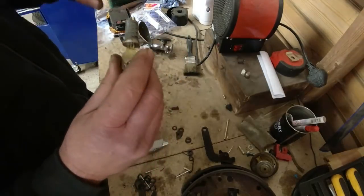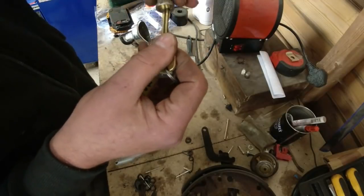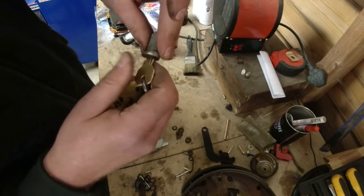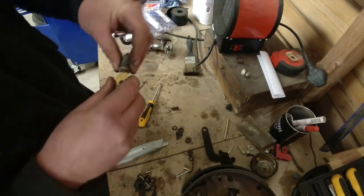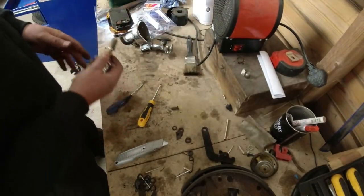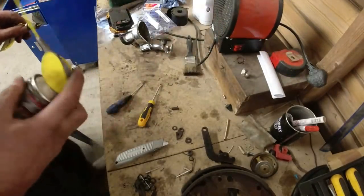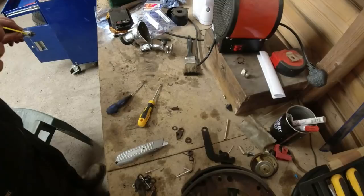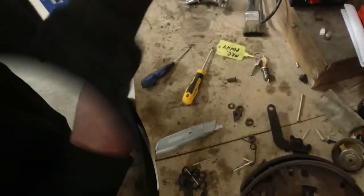And that's the lock barrel. You see all the levers go in there. But when I pull the key out, these levers should all pop out. They don't. So I might have to put a bit of releasing agent on that. I'll loosen that up. This is a lot of graphite. Fast release penetrant. Let that soak for a minute.